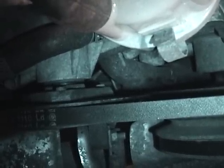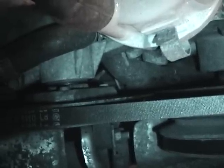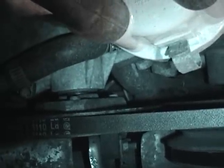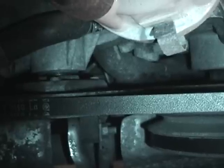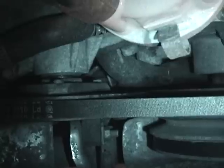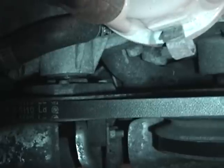Basically, if the engine has low oil pressure below around 2000 RPM, the low pressure switch kicks on and the oil pressure light will simply come on on the dash. However, if you're over 2000 RPM and you have low oil pressure, the high pressure switch kicks on and then the oil light will blink and you'll get a loud buzzer. And that's what happened to me on the highway last night around 10 o'clock.